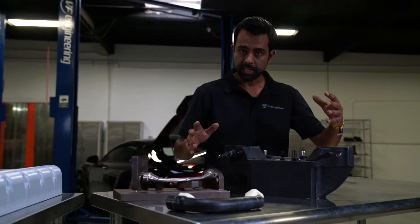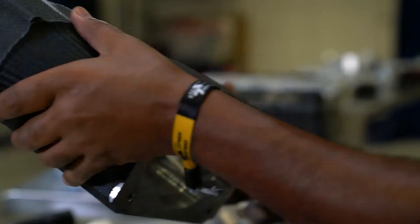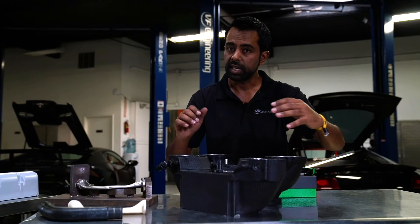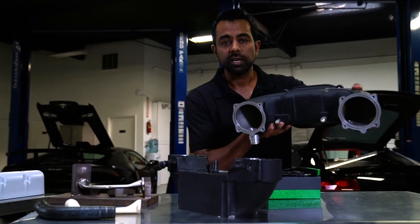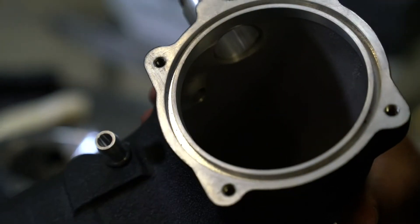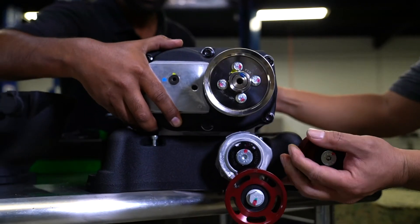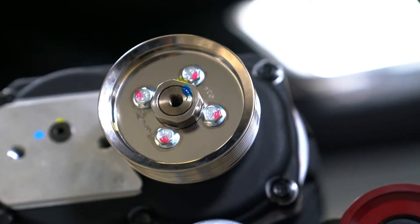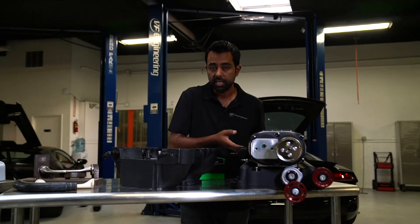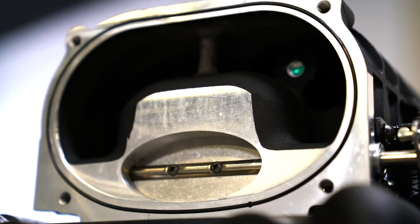One of the last pieces of the hardware system is the air intake for the supercharger. You can see this was made 10 years ago, hogged out of a block of aluminum and designed for pure prototyping. That was then created in SOLIDWORKS in CAD, and we created a cast finish — a 356A aluminum casting with press fit and push fit fittings — ending up with the final piece. The supercharger's actual compressor head unit is from Magnuson with the Eaton TVS 2300 rotor group, and our own manifold with integrated air-to-water heat exchanger, a tensioner system, internal bypass system, and the inlet which mounts to the back.